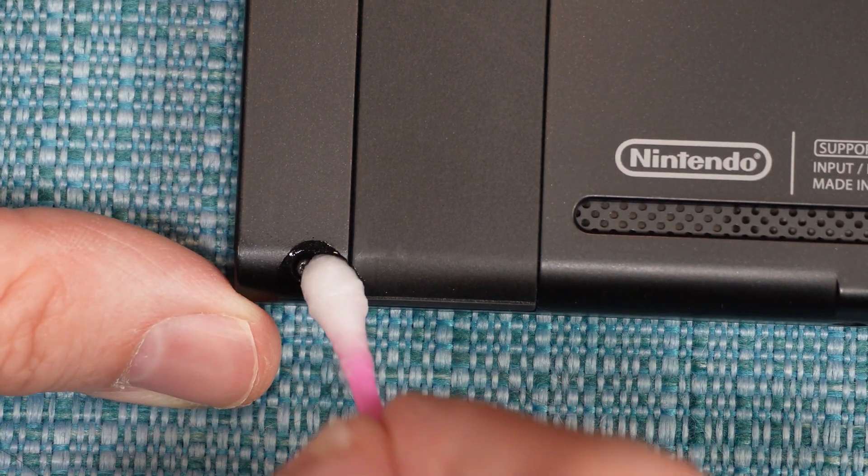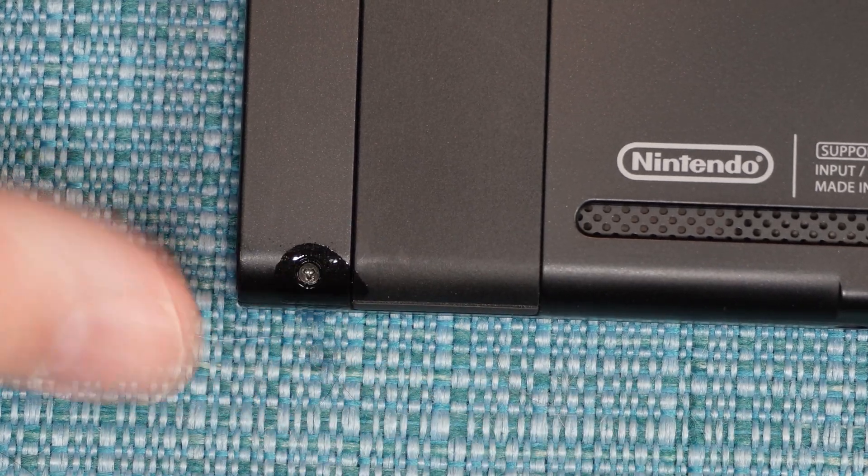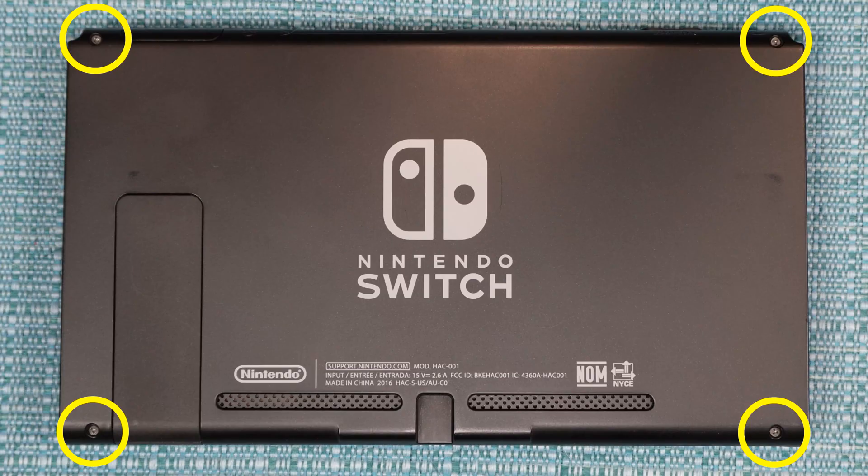To facilitate that, make sure there's no debris around the screw, and if there is, just clean it out. A little bit of alcohol helps. You can also tap on the screw, and that could loosen up any dirt that's underneath it. The first four screws to remove are on the corners of the back, and those will require your tri-wing. These are the only four tri-wings you'll have to worry about today.